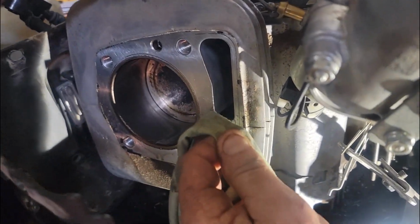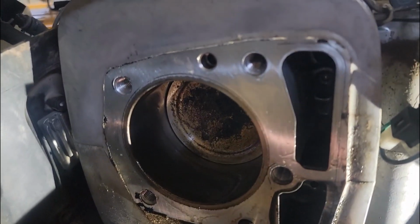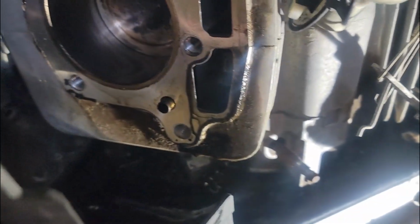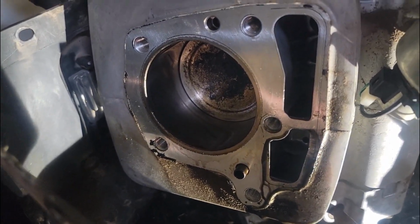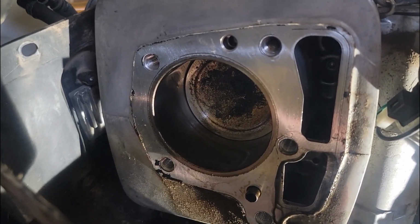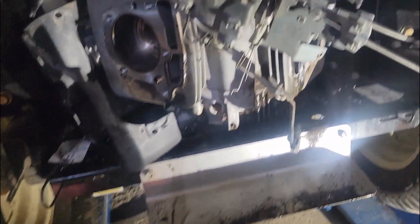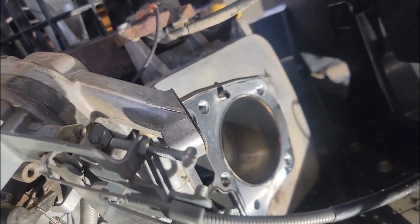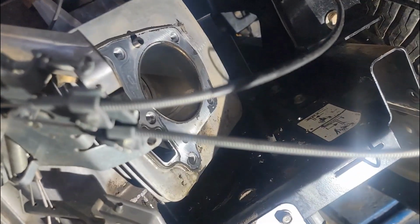I'm going to check the gaskets over super good and start cleaning everything, but like I said, I'm kind of excited not seeing a problem. What I'll do is I'll use Scotch-Brite or fine sandpaper, and I want to clean the head up here, get it spotless, and then I want to maybe use a small brush wheel, clean the top of the pistons off, and then we're going to look at the heads. We'll see what's going on with them. I don't know if we have any problems here. The locator pin up here, the locator pin down there, everything looks correct on it.